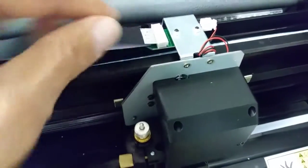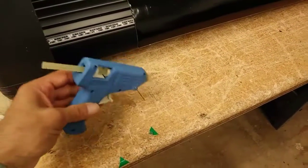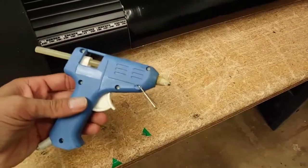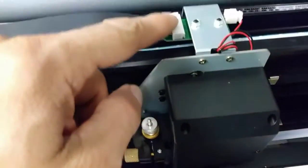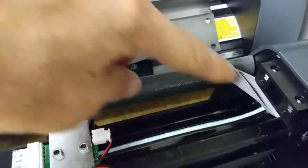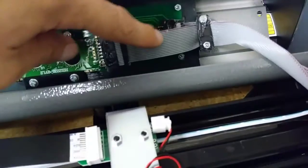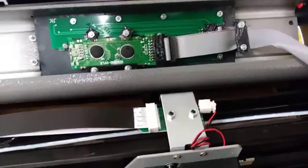What I'm gonna do is use this glue gun to make sure it's snug and secure. I'm gonna put just a couple dabs of hot glue right here — don't do too much or overkill, just a little bit. If you get anything too high above this level here, it's gonna catch on this ribbon or it may catch on the control panel or the button board, so you want to be a little careful with that.